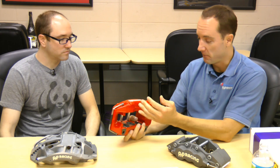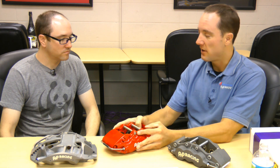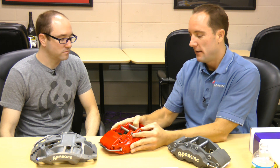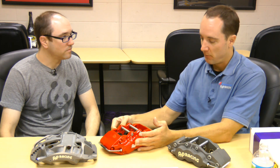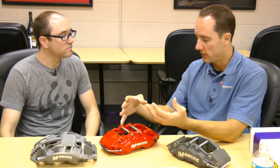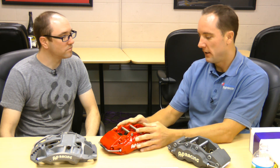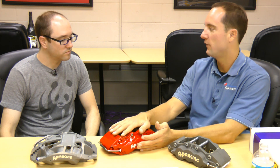This is an extremely capable caliper, capable of heavy racetrack use. It's just not quite as optimized as a full-out race caliper. So if you drive in both environments — street and track — this is a great product because you're still getting the bigger disc with the directional vanes, the J-hook slot pattern, and all the benefits of the fixed opposed caliper. Many of the benefits of the full-out race kits are also found in this kit; it's just not quite as extreme.